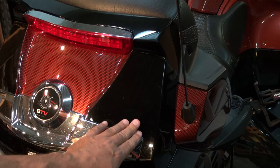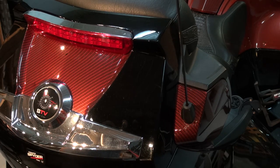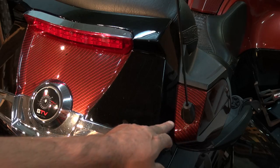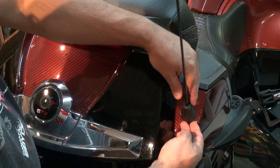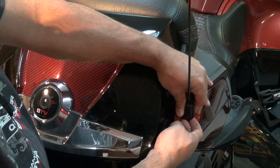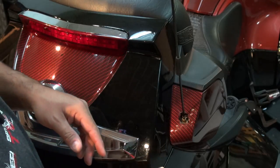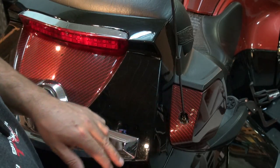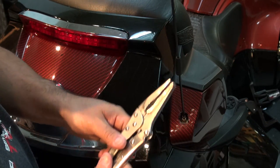First step: if your antenna is still intact and hasn't broken off, it's going to look something like this. If it's broken off, then you've got different pieces left or the whole thing might have come off. To remove the rubber part, the easiest way is to simply put two fingers underneath, two fingers on each side, squeeze it and wiggle it a little bit and it'll come right off. Then we're going to need to unscrew the antenna using long-nose pliers or vice grips if you have them.